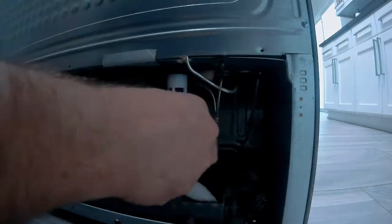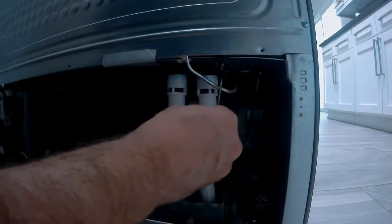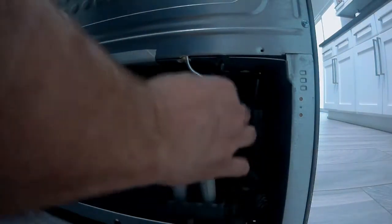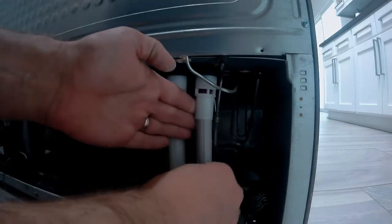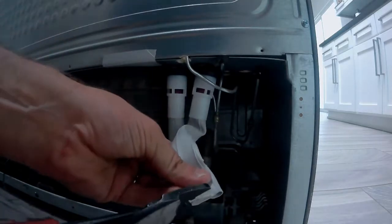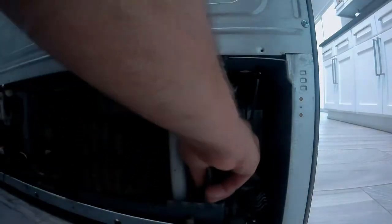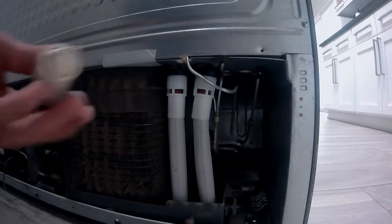You'll see here, this one didn't fit, so I took a little shortcut and trimmed a little bit off the bottom. That's all right, as long as you don't do any more than the amount that I took off here. Sometimes I don't want to fit up around those tubes, but just make sure it's on all the way so it doesn't come off in the future. If you get a little kink like that, it means you need to trim it some more. Just took a small bit off the bottom, make it fit a little better. This tube, all it does is water travels down it from inside the machine during defrost or other types of cycles where it's not exactly cooling. I want to make that probably a little bit straighter than that.